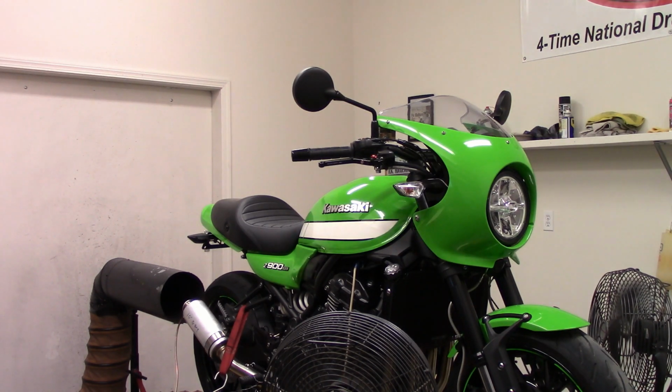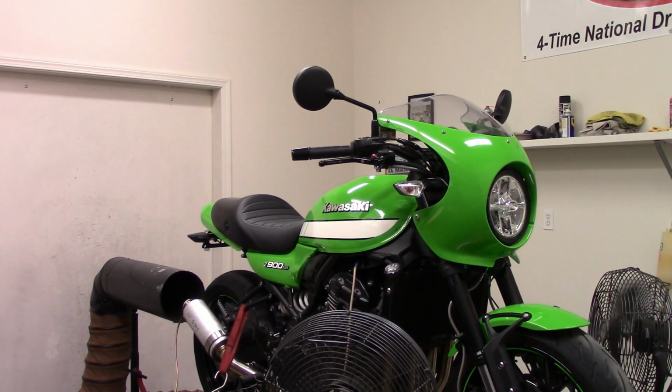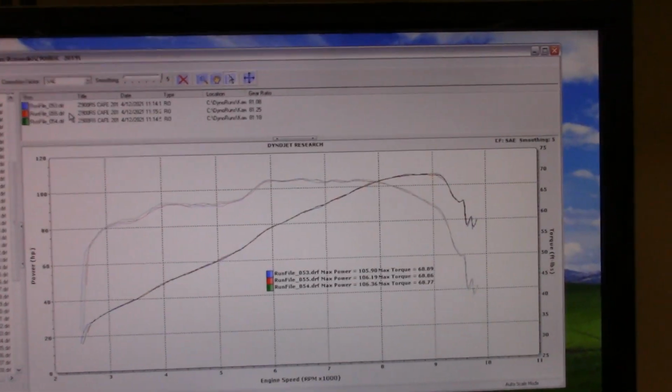Everything's got to warm up. I still got to get a few more degrees in here, get it around 78. And now the chain, the tranny, the oil, the dyno, the drum, everything's warmed up. So as soon as I get the temperature up more, the next session of runs. I usually do 3 or 4 pulls per session with about a 10-minute cool down and control the room. So we're not even close to where optimal will be yet, but anyway, it sure sounds good. Okay, I'm gonna shut this thing off for now. Be back. Well, here's those very first pulls.